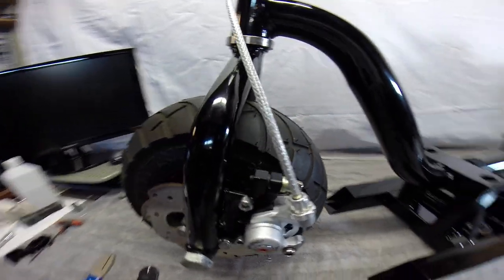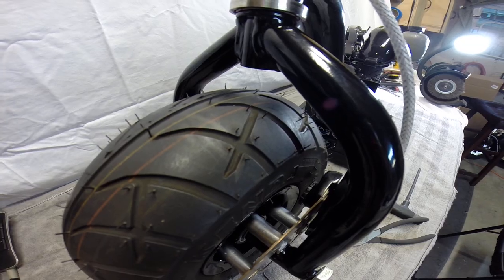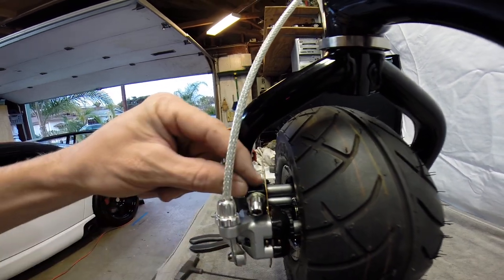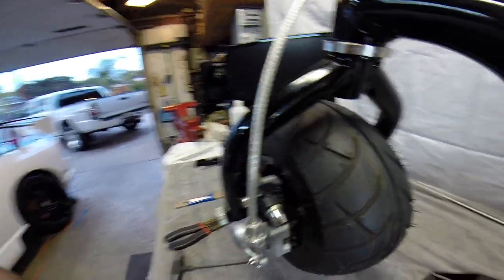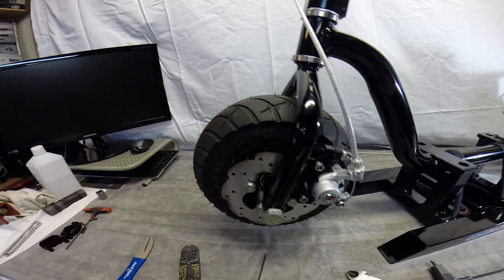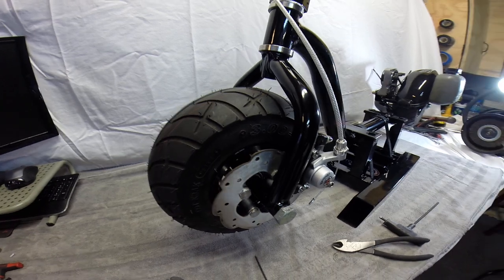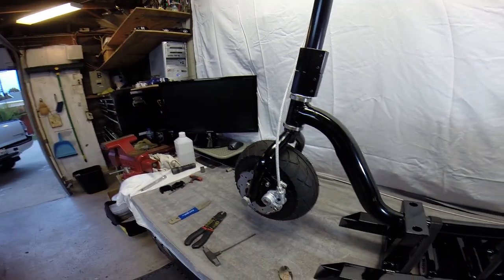This little dial right here is all you really want to have to adjust if you can. Also, these two bolts right here — if you loosen those up, that gives you a little bit of play in your caliper to move it back and forth to adjust it, for any fine movements to dial in your brake pads and get everything lined up perfectly. I've been playing with these brakes for quite a few years and I've learned a lot — practice makes perfect, that's how you learn. If you guys have any questions, send me a message or post in the comments and I'll be happy to help. Thanks for watching.